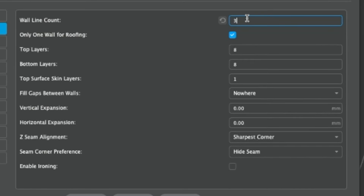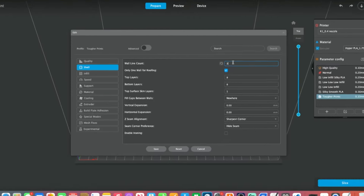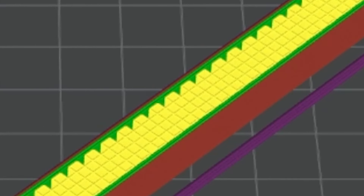Tip 2: Optimize the wall thickness and infill percentage. Increasing the number of walls in your slicer settings can really improve the strength of your prints. Aim for at least 2–3 walls for sturdy prints. Additionally, adjusting the infill percentage can reinforce the inside and solidity of your prints by providing stability to the surrounding walls. You can use whatever infill suits you best, but I usually try to go with a 45-degree cube angle infill.